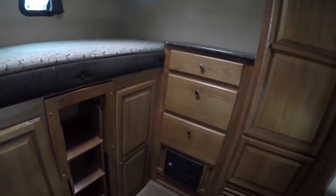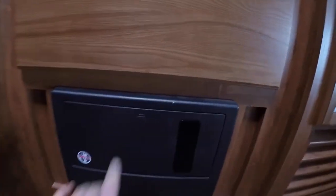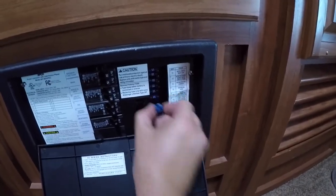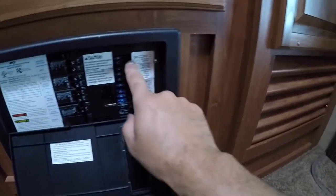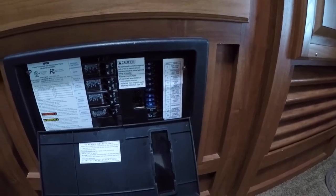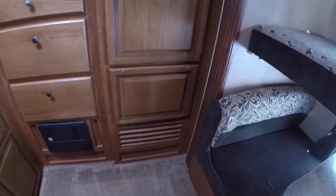Lots of lighting throughout. You have a ladder here for the upper bunk. You have your converter here with all your AC breakers and DC fuses — if one is to blow, that's where you replace it. There are little red indication lights along the side, so once plugged in, if something happens and you blow a fuse, that red light comes on to let you know exactly which one isn't working, or if the breaker trips. If something isn't powered, come check here first. There's also access here with four screws — that's access to the hot water tank, so when it's time to winterize and you need to switch the valves over, that's where you go.